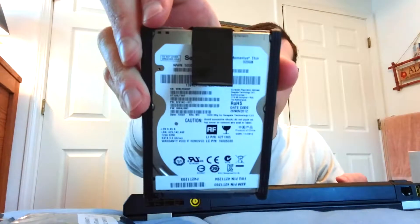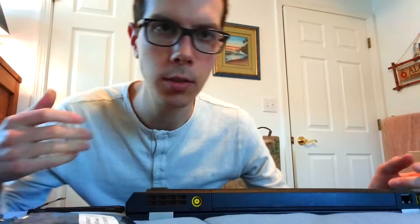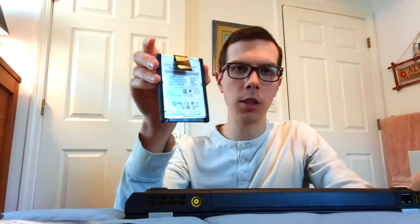What I'm going to do is use this as a kind of NAS — like a network attached storage. It came with a 320 gigabyte hard drive, which is not big enough for a NAS, at least for my stuff. So I bought two two-terabyte hard drives. I also got an external two-terabyte hard drive for off-site backup. That external hard drive is actually cheaper than the internal ones, which I don't think used to be the case — now that externals are more popular, I guess supply and demand.